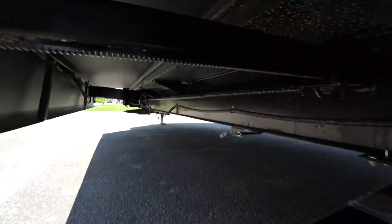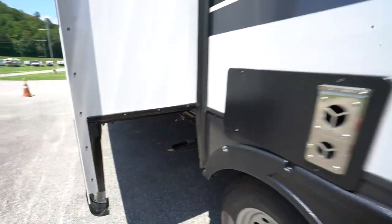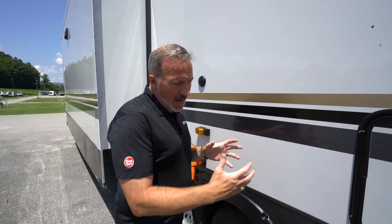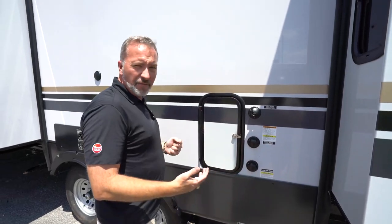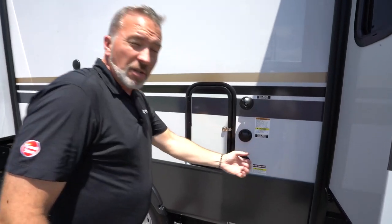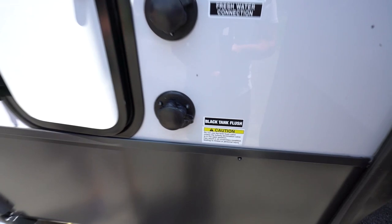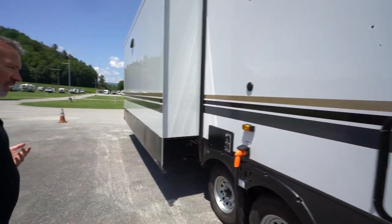You don't have to keep the tanks open when you're set up — it's good if there's some water inside those tanks. If you're going to use the black tank flush or dump everything, make sure to do the black tank first, then do the gray tank so it kind of washes everything out. If you're flushing the black tank, make sure the black tank is open. A good rule of thumb: if you have a clear elbow, that way you can see when the black tank is actually clean.